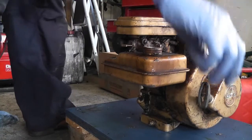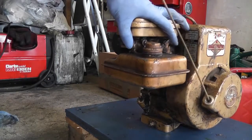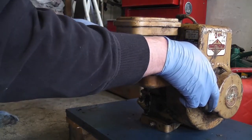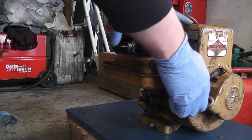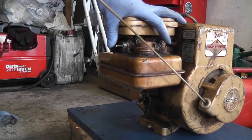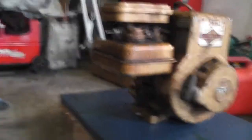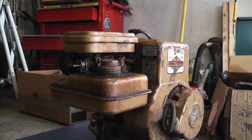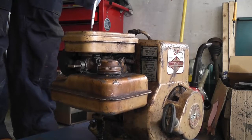Here we go, a bit of petrol in it. I haven't even checked to see if there's a spark. Now you pull this, the choke is now on, it pulls over really easy. Okay, so we're not getting anything, so let's back you guys up a little bit and have a quick look and see what's going on. The first thing I'm going to do is pop the air cleaner off, have a look down there, and then have a look and see what we're getting as far as the spark is concerned.